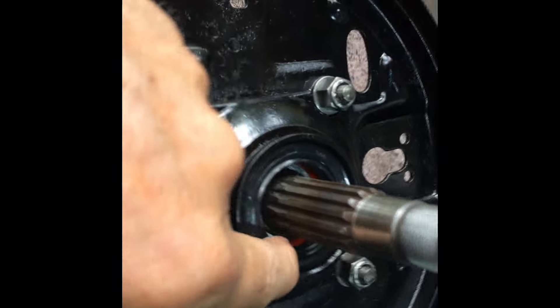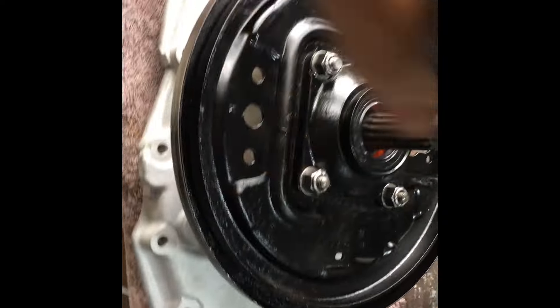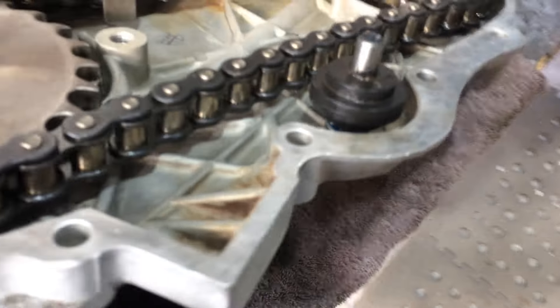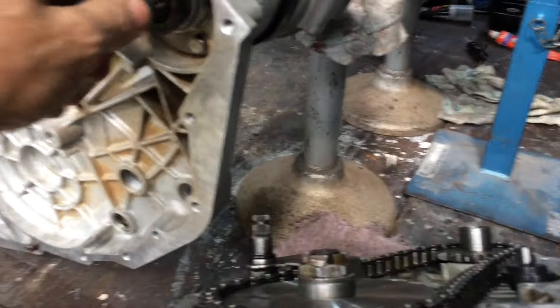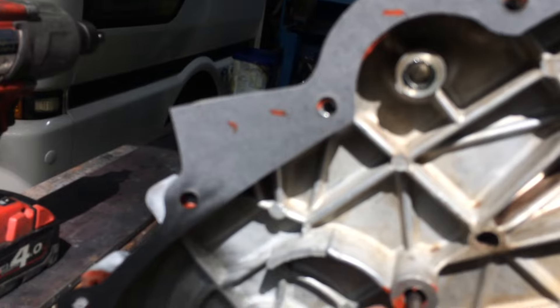Lastly you put your seal - that's the one with the 37 ID because it's got to run on that sprocket. I'll give that a little sand, put some grease on it, and throw that on. When you tighten that, it tightens the chain - it runs off this little roller thing at the top as well. Those rollers are in good condition, nothing wrong with them. I'll put on the gasket and throw it on. There's an o-ring on there, they've all been replaced. I'll put a little bit of gasket glue to hold that washer in position.